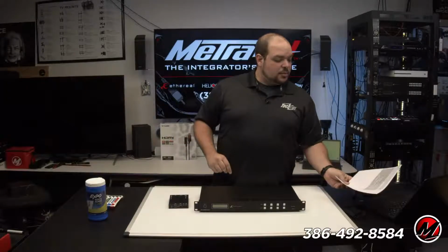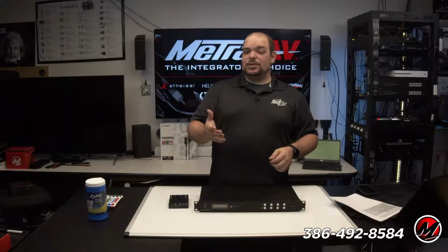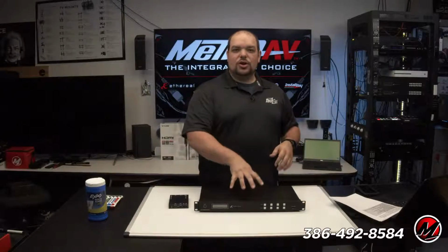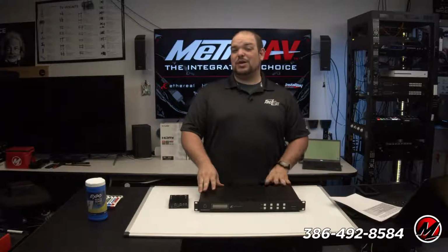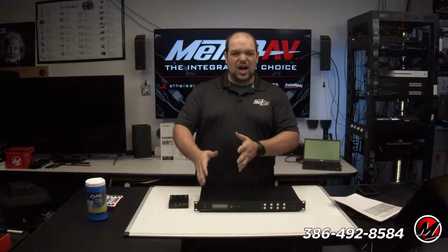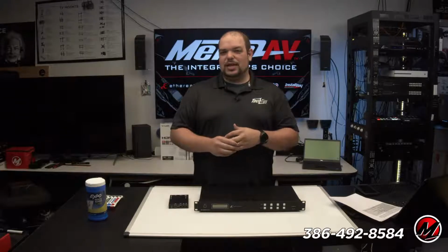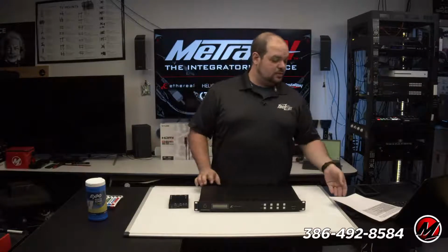So some of the other really cool features that this has, before we talk about the RS-232 control, it has built-in EDID management. Brent and I did a really great episode on EDID management and why it's important. This was kind of the star of the show for that episode, because this has EDID management built directly into it. So all 4 inputs can have different EDID information for each one. So if you have a source device that you need to say, hey, you are only 1080p, you can do that. And then you can say another source, hey, you're connected to a 4K display, you can do that as well. You can also copy the EDID information from the TVs that are connected to this and send that EDID information back to the source device. That's important when it comes to certain devices. Samsung's a really good big one on that, to make sure that you send the correct EDID information back to the source device. That's really important for those types of devices.